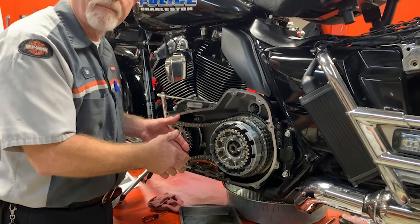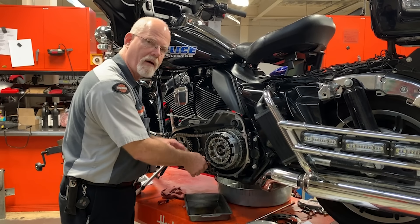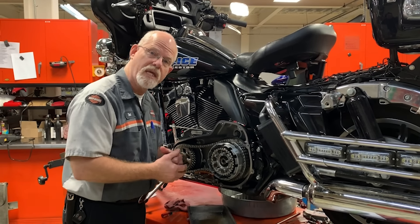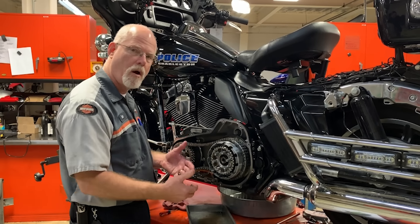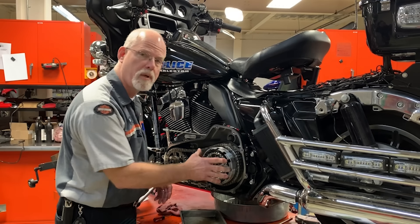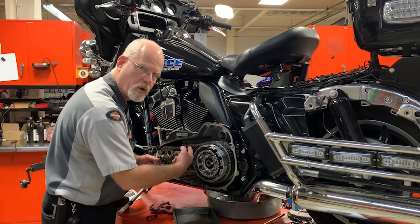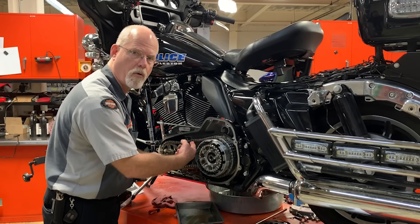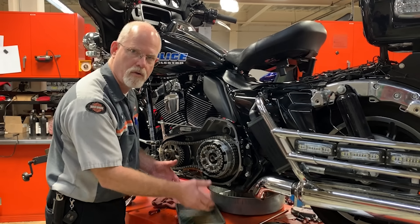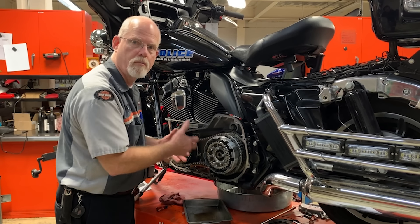For a stock Harley-Davidson, I have many customers with over 100,000 miles still running the stock primary adjuster with bearings and adjustment fine. If you're curious whether your weekend shenanigans caused yours to ratchet up too much, you can check it: hold the bike upright, take your derby cover off, and slide a long screwdriver in with a flashlight to move the primary chain. If it moves, you're fine. If it's bone tight, consider pulling the primary cover, draining the oil, and readjusting the unit down to minimum so it can ratchet back up to where it should be.